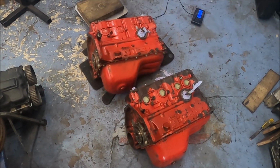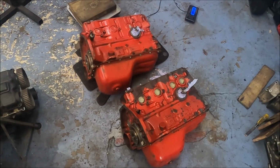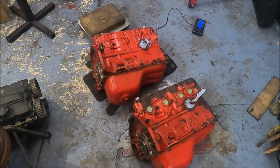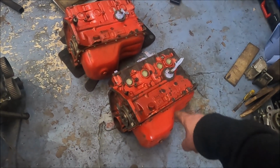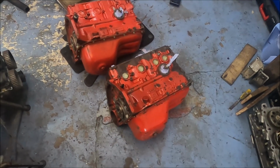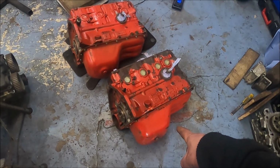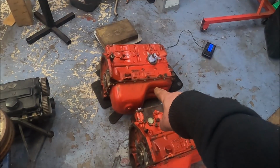And then I thought, hang on, I hadn't really had a close look. So I had a close look, and it turns out they're really very different to each other. This video is going to be all about the differences, and they are really different. This one has B230 and then an R. There are some legendary, almost mythical, Volvo R blocks, like the ones used in racing. I don't think this is one of them, but one thing's for sure, it's really, really different to that normal one.